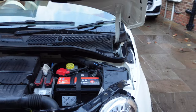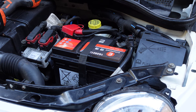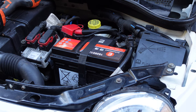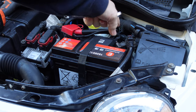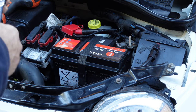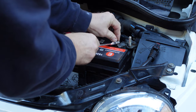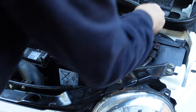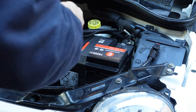In the meantime, we'll get the connections off the battery. Please forgive me if this is teaching you how to suck eggs, but I'm trying to save people a lot of money doing this — people who haven't got a clue about how to do things on cars. It is a learning curve, but if I can show you how to do it, it will save you quite a bit of money. To get the battery quick release off, you have to press the little red button on there, press it in and then it just pulls off — that's just disconnecting your earth. Then if you've got a 10mm ratchet spanner, they're the best things to use because you haven't got to keep going on and off. So you loosen that — don't bring it out, don't take it off all the way, just loosen it off.